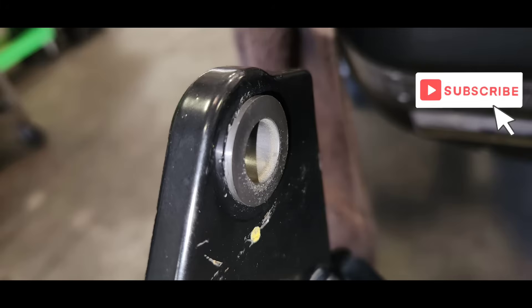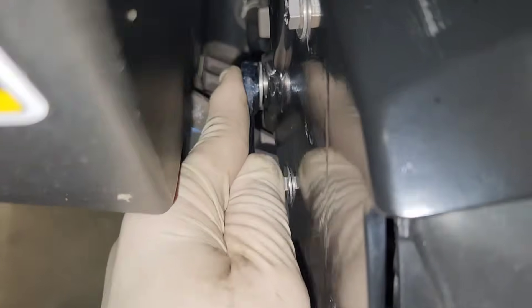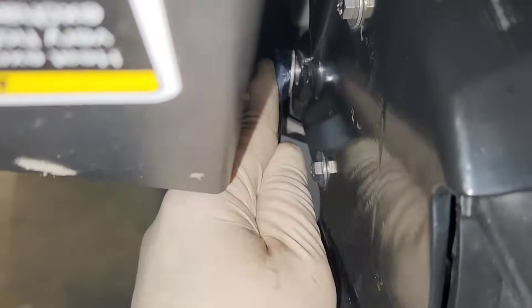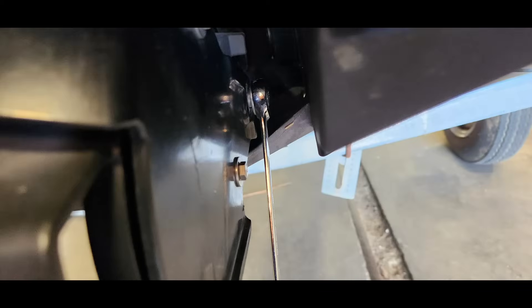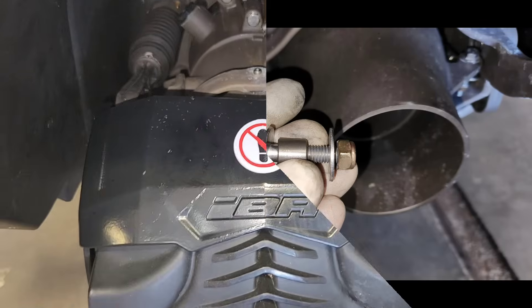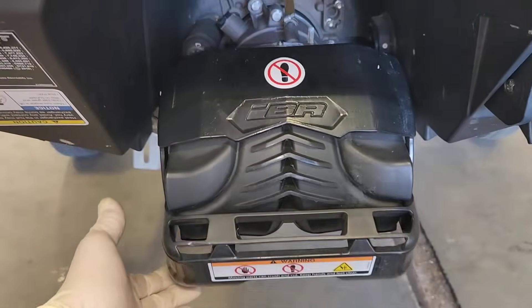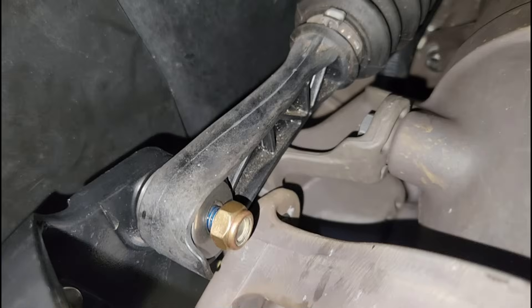If you haven't yet subscribed to my channel, please take a moment and do so — I have a lot more videos to come. Apply blue Loctite on the gate pivot bolts and use a ratcheting 13 millimeter wrench to install them. This is what the hardware looks like for the reverse gate to attach the IBR motor arm. Before installing the IBR motor arm mount hardware, make sure the gate moves freely, then install the hardware as shown.